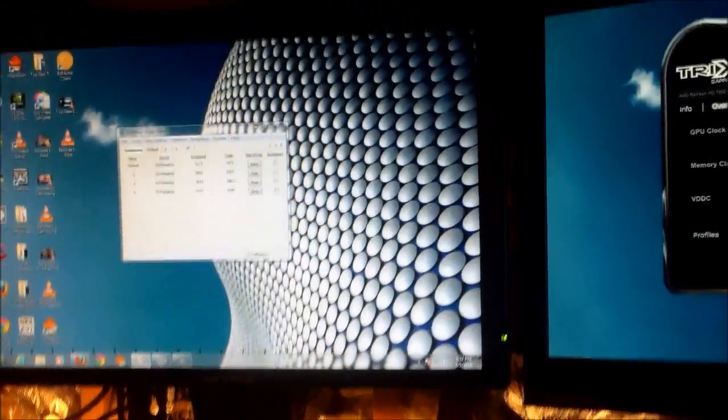Yep. I'm running Litecoin mining at this time, and I'm making just under 3 Litecoins a day, about $10 per day on this rig, minus power, which is $1.50. So I'm making about $9.50 on this rig per day, and I'm running 600 watts right now. How many amps? 5 amps. Yep. So yeah, 600 watts.